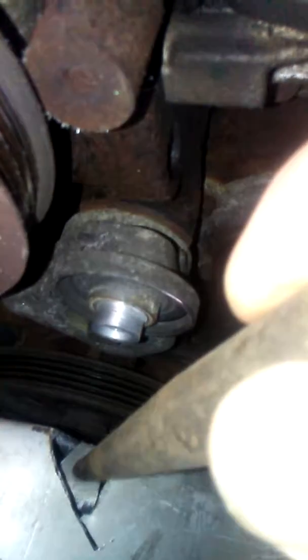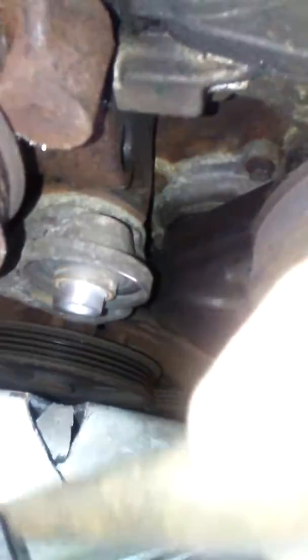I cut that V, and using this punch I just hammered this metal up inside the frame, which allowed me to get the bolt out of the hole. I hope that helps — just put that punch right there and hammer up.